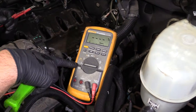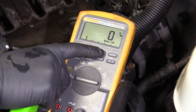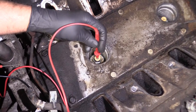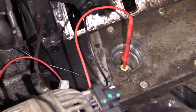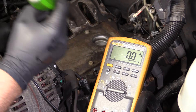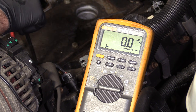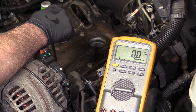If you take your meter and put it on AC voltage, go to range, and set it to millivolts. Now, just the leads being out in the air, it's going to fluctuate. But if you take one of the leads and put it on the sensor, and then ground the other lead — just find a good ground somewhere — look at the meter and it's at zero. Just take a screwdriver and tap right here, and as you tap you can see that you're getting a reading, and that's what a good knock sensor looks like. If it wasn't doing anything when you do that, then you'd know it's an open circuit in the knock sensor itself.